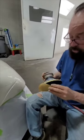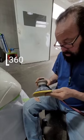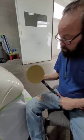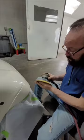I'm getting ready to sand. I'm going to use 360 sandpaper because it cuts a little faster, and this is a three-stage paint job — I have to paint it black first, then I'm going to put a metallic over it, and then clear coat it.